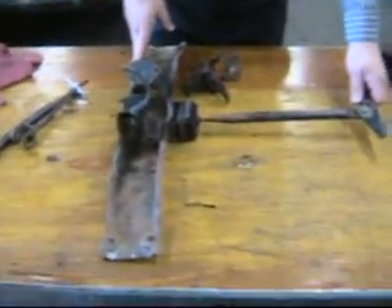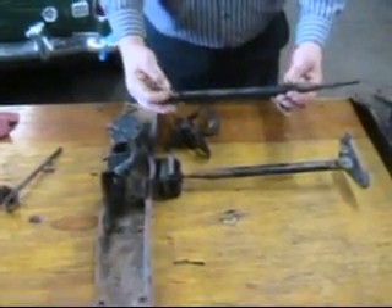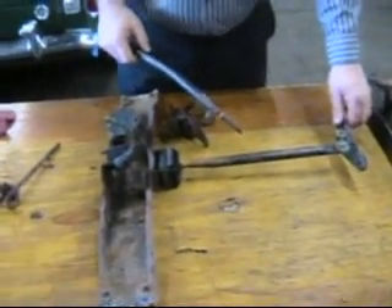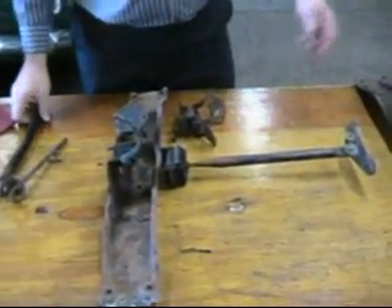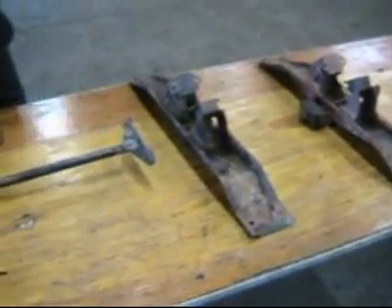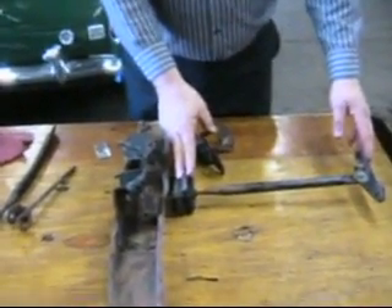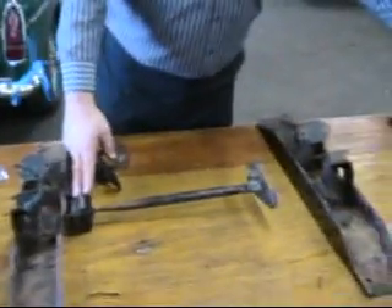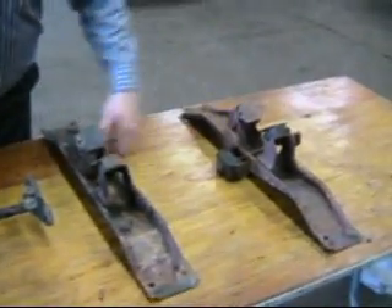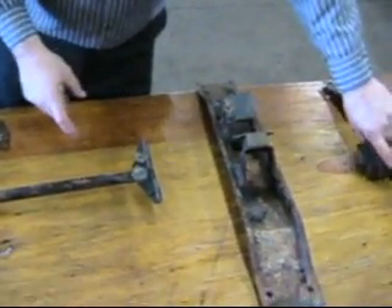This style is added on, I think, for 74 and a half through 80. This rod — this one's bent, maybe from a collision — is again to keep the gearbox secure, just as the earlier style was, which the middle ones from 68 through 74 were not. This rod runs off the front of the crossmember, whereas on the earlier one it goes through the hole in the back and fits onto the attachment in the back.